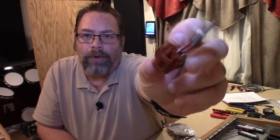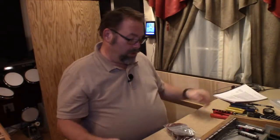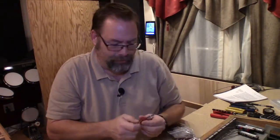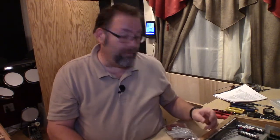Here's what a connector looks like up close with wires in it — those wires have to go in a very specific order as outlined in the manual. It tells you exactly what each one of those pins is. These are 12-pin connectors, which are two stereo pairs. If you get the pins in wrong — which I've already done since I started this install — you take the pin extractor, stick it in the hole, work it in until it snaps in place, then press the shaft and it pushes the pin out. It's not easy, it's a pain, so the best advice is really try not to get the pins in the wrong holes.